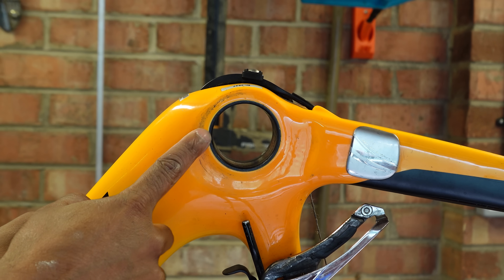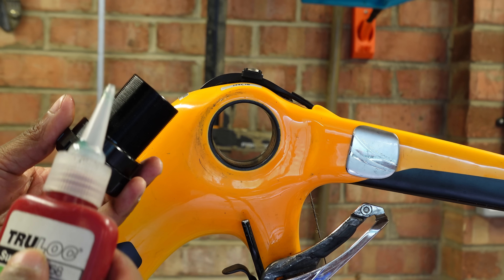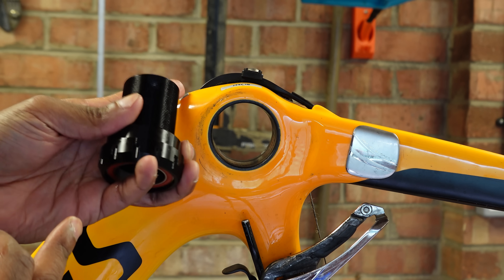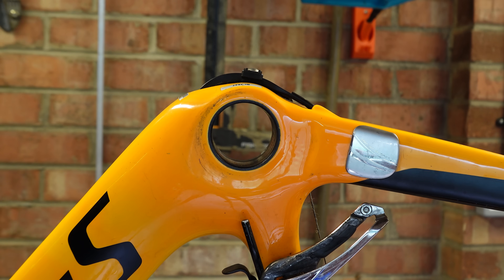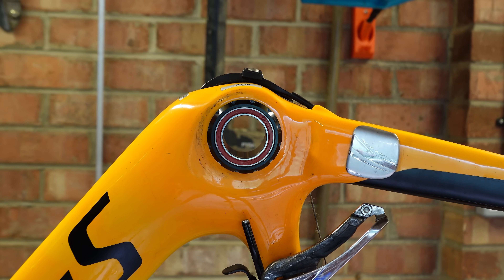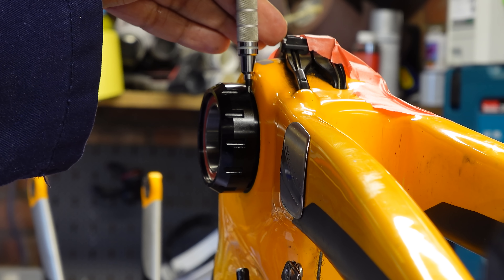I haven't faced around here because I was worried it was all going to flake off, so I've left it as is — it is fairly flat, I've checked it. To get this going I'm going to use a little bit of retaining compound — basically Loctite in all but name. I'll line up my index mark with the reference number BL2567 on the bottom bracket. I've pushed it in with the press and left it slightly proud — you can see there's a small gap, about the size of a pencil nib.